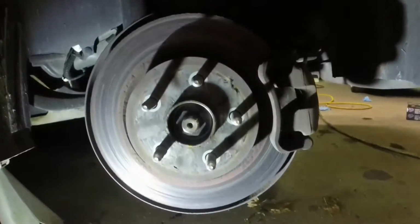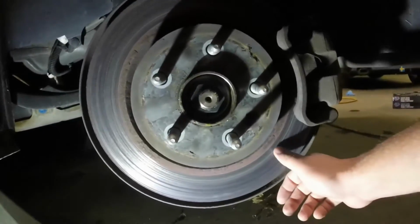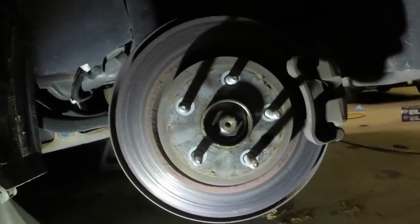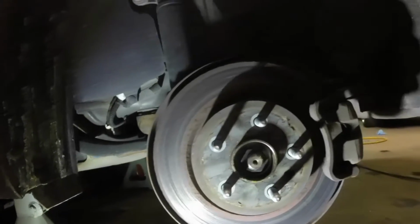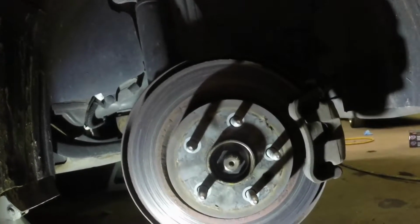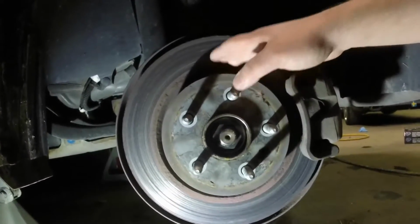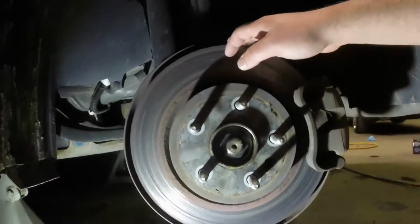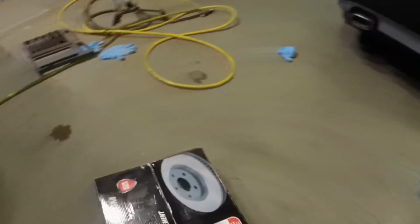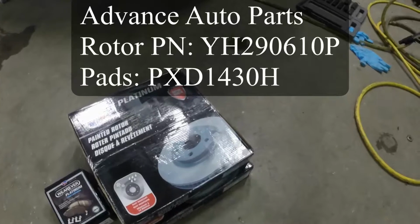parts. And they were actually not showing any brakes for an NG95, or I should say any rear rotors for an NG95. So what I did was I grabbed the part number, and these are vented. I went on Google, did some research, found out that these are 315 millimeter for the vented ones. And then I crossed them and found out that these are just Buick LaCrosse or Regal GS rotors. So what I did was I went and I bought Buick LaCrosse rotors. So we're going to find out how these fit.